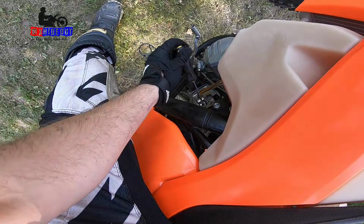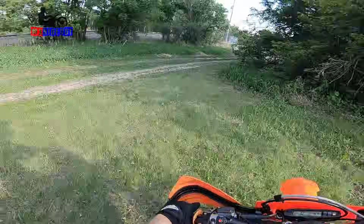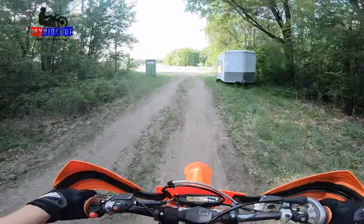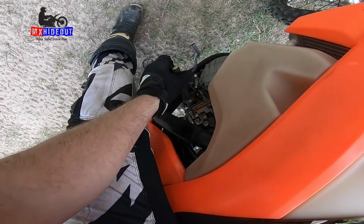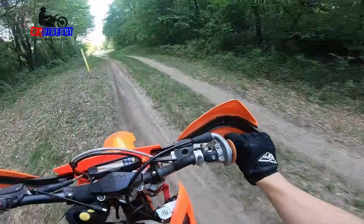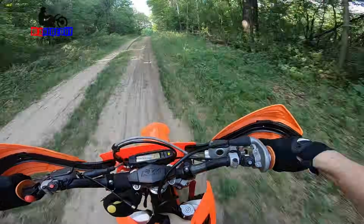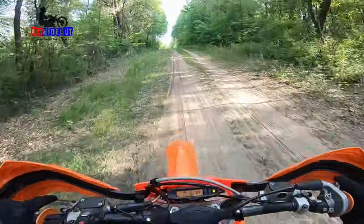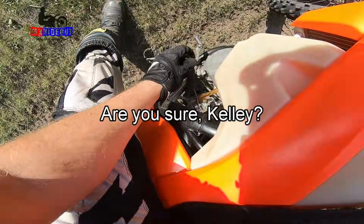Let's go back leaner, 1/4 of a turn on the power jet. So get that little bit of a lean bog. Yeah, it's still rich on the top end. We'll go another 1/4 turn leaner on the power jet, see if that cleans it out. Just seems to be more sensitive to changes than a traditional carburetor. So 1/4 turn. Better, but still too rich. Once again, a little bit better. 1/4 turn leaner. Better again. So another 1/4 turn leaner.